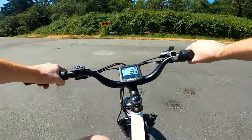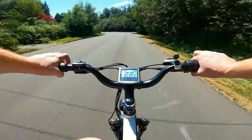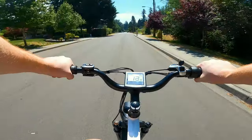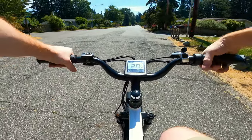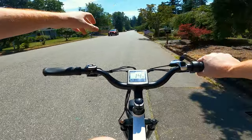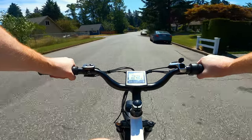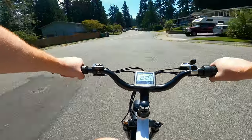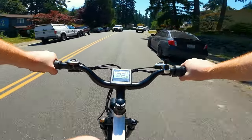Let's do a brake test and see if we can lock up the tire. The brakes feel a little mushy. You can lock up the rear tire but not the front — that's good. Both at the same time — pretty good emergency stopping considering they're just cable-actuated disc brakes. You do have to pull harder because they're not hydraulic. A lot of bikes have rotors that are too small, they heat up fast and you lose braking power after a couple of hard stops — the brakes just turn to mush.